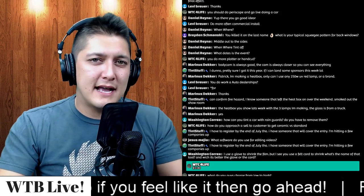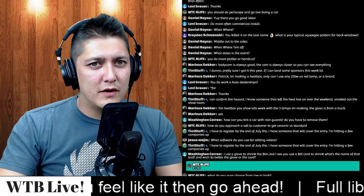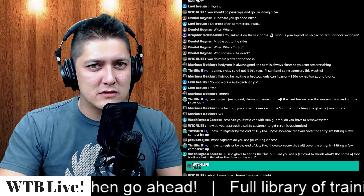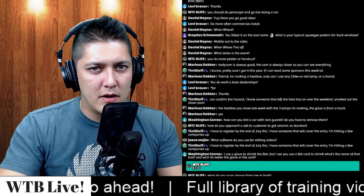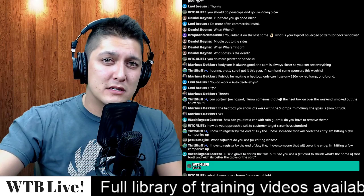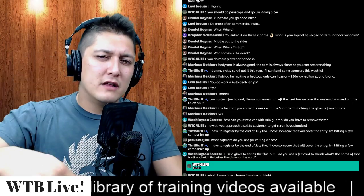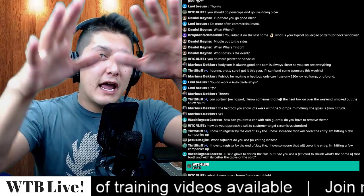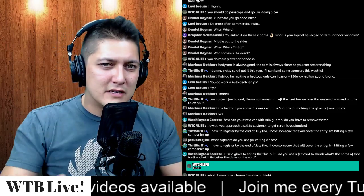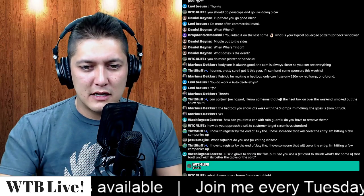So I've always used the MacTac, and it's always very forgiving. If you use a hard card and you throw a crease in there, usually that crease is going to lay down so hard that you're not going to be able to save that film. But with the MacTac, let's say you don't shrink it enough and you put a little crease on there, most of the time you can lift up the film, reheat it, and heat that crease out. But with a hard card, like a Bondo card or a Teflon card, you're smoked. That's pretty much a wrap.